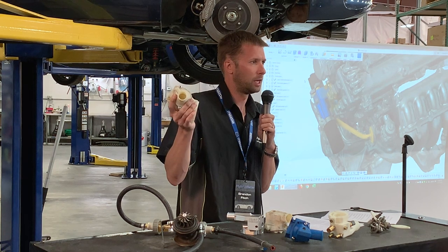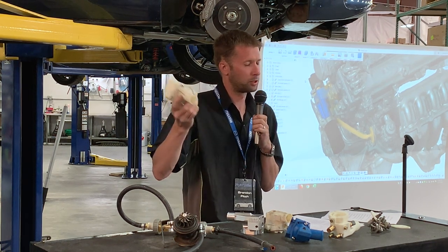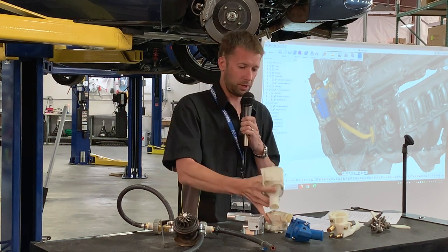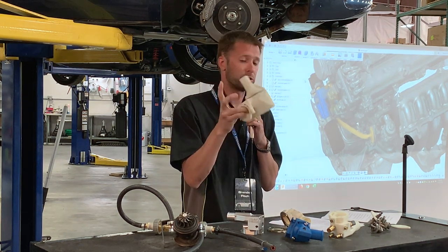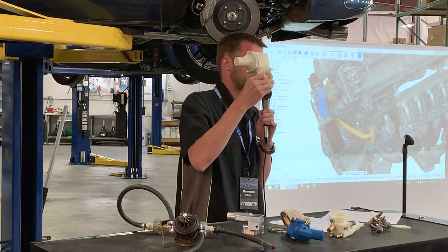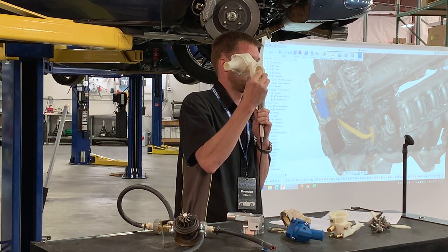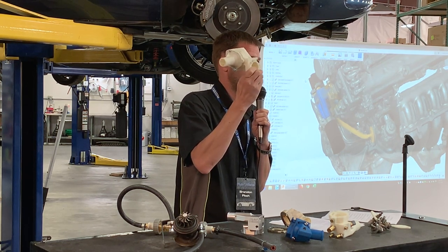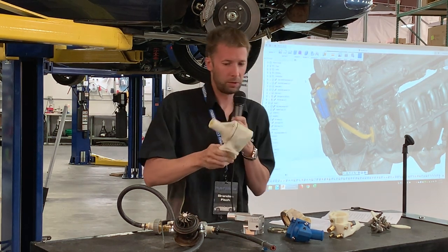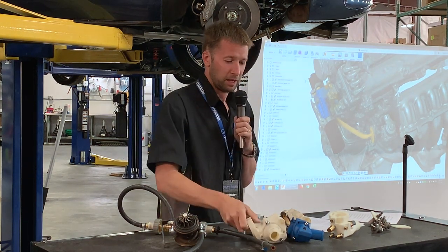And again, we don't want a lot, like I was talking about earlier, but this one had decent flow through the turbo. Unlike this one, I was a little conservative on the EGR space, so it was real tight in here. So we saw a pretty good hit to the flow through the radiator with this guy. So that went out the window for that reason. Plus, it's just giant and ugly, honestly.